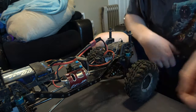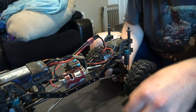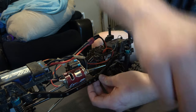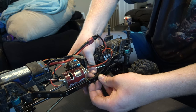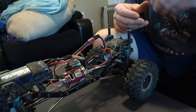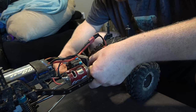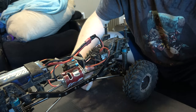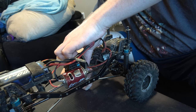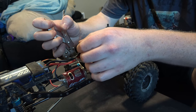All right, I have made new holes a half inch away. And they are deburred. I actually used another drill bit to deburr it because apparently I do not have, excuse me, a deburring tool. Yeah, that rotated our axle quite nicely. So now we have a good pinion angle, and then we can figure out how long we need to make the drive shaft. I'm wondering if we just need to cut a half inch off the thing, because we need good up and down movement, so I'll figure that out here in a momento.